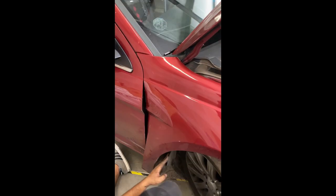The next step would be a bolt from the back. You've got to push that fender liner to the side. That bolt for the fender is right back there, once you take off that foam piece. I'm going to go ahead and take that off with a 10 millimeter — I can see the bolt.